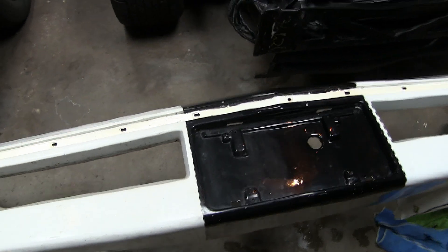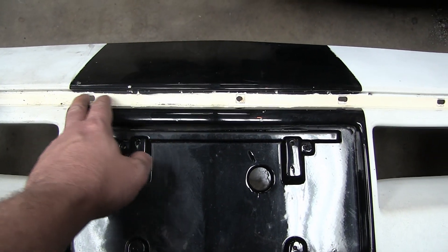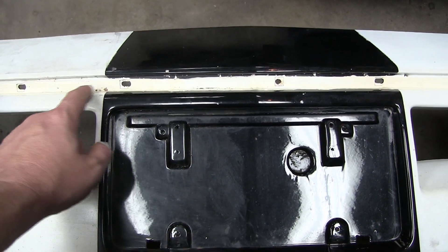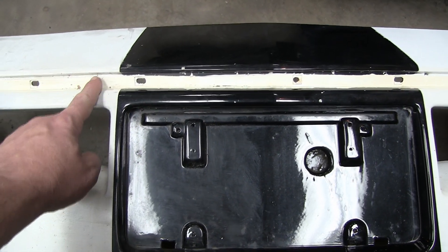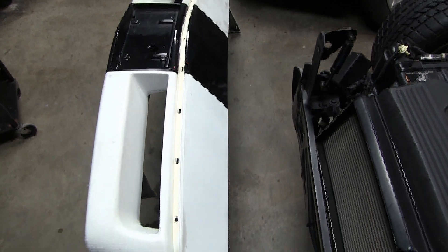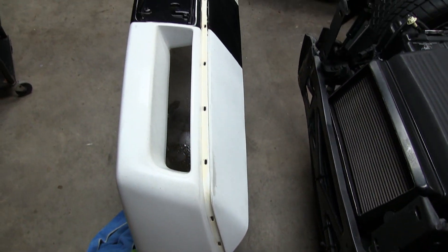This has also helped me to see what I'm working with. Here's another good example of how if I didn't get that belt molding off, the black wouldn't continue down through here. You're going to see it — this bumper's been repainted. This white here is probably the original white of the car. I can see where this kind of white drops down on the edge — they painted it with the belt molding on the car. I just want to clean it up so I'm not handling it and getting it dirty again, and it'll help me know what I'm working with as a baseline.